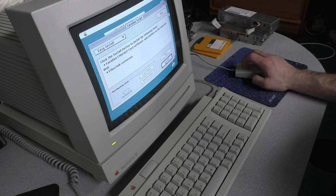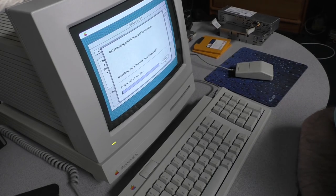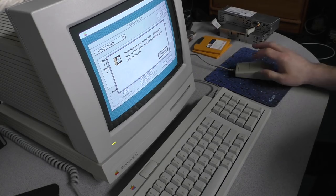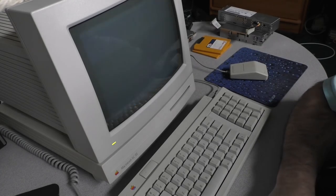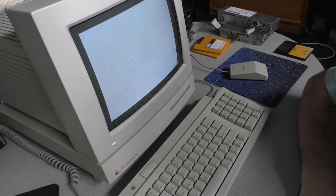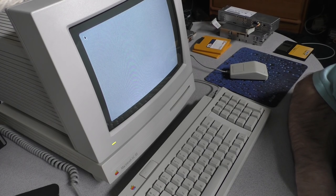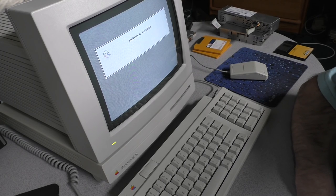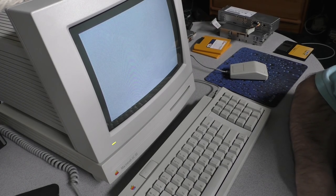So we're going to now install the Farallon adapter driver. And again, we're going to do the same thing for the 575. And someday, I will probably link these together. To link these two machines together, you will need to build a crossover Ethernet cable, but that's not a problem. You can still make them, you can still buy them. That's what you would need a crossover for if you didn't have a switch or a hub. Or you could use a hub. I don't have a hub right now, but I can make it work.